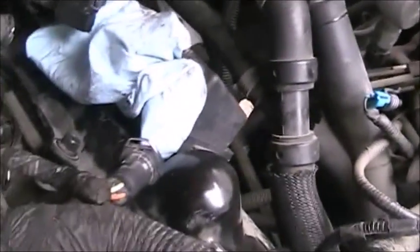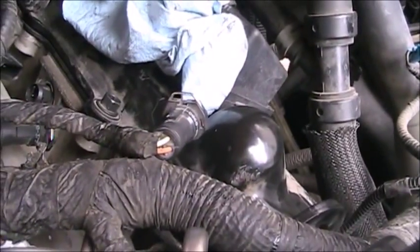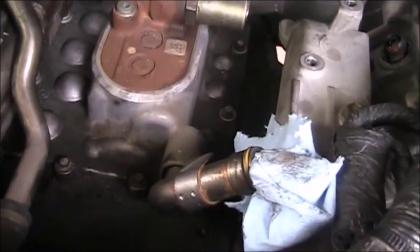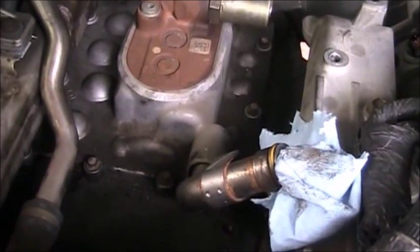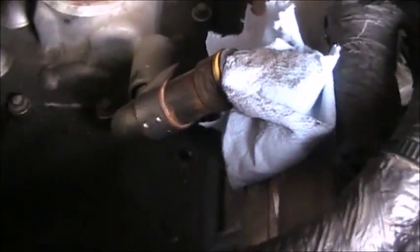There was some time between figuring out what was wrong with this thing and getting the parts in. I've already ordered a complete update kit. After I figured out and found that dummy plug was bad, I went ahead and put the valve covers back on. The less dirt you can get in these things the better off you're going to be. That dirt ends up getting caught by the oil filter, but any that gets past it before it gets sucked up into the high pressure pump right here — that dirt is going to end up in the IPR valve screen.